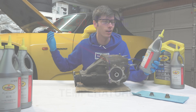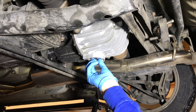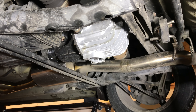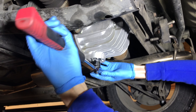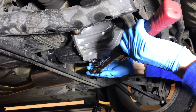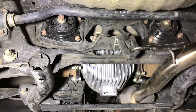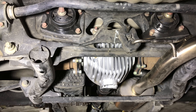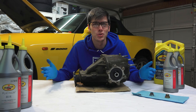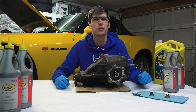I'm planning on putting more power in the car at some point and having some fun with it. When you're putting additional heat through the differential, you want to make sure it's protected. The builder recommends using the 75W140 for more protection at higher temperatures, assuming you're actually putting more power through it. If you're just driving around town without heavy demand on the differential, the stock recommendation is certainly the way to go. A huge thank you to Pennzoil for sponsoring this video — if you have any questions or comments, feel free to leave them below.